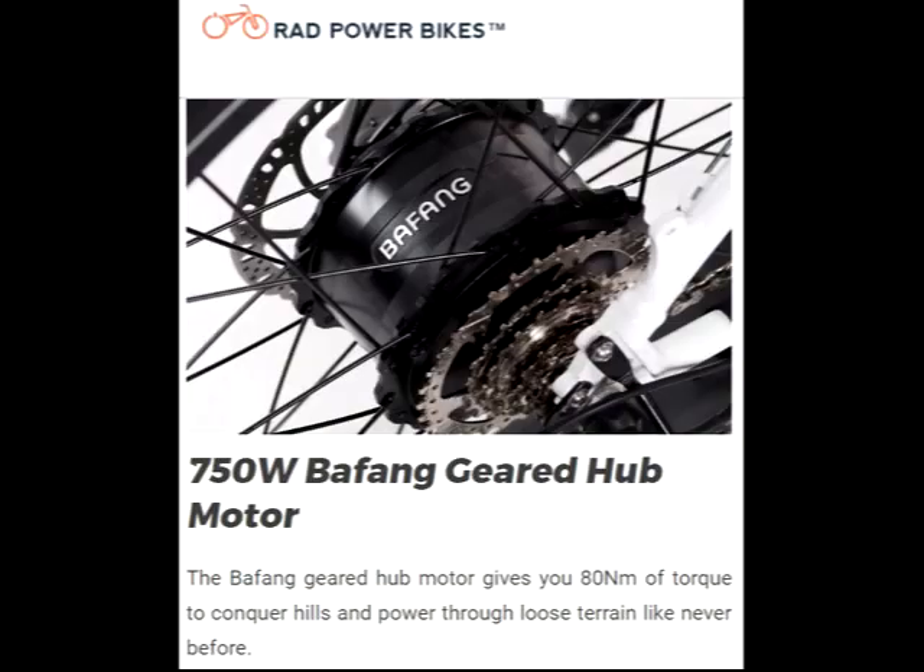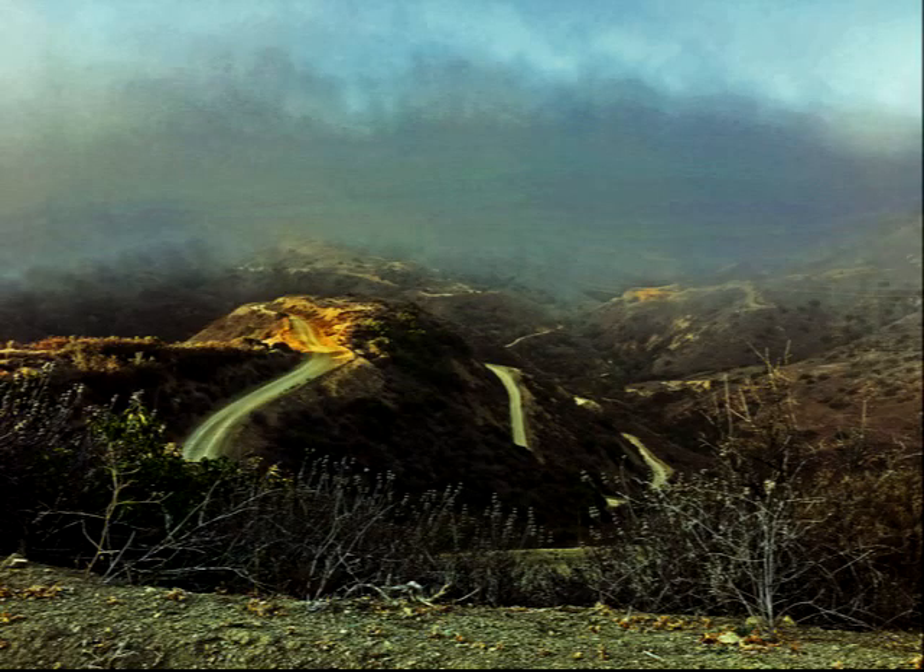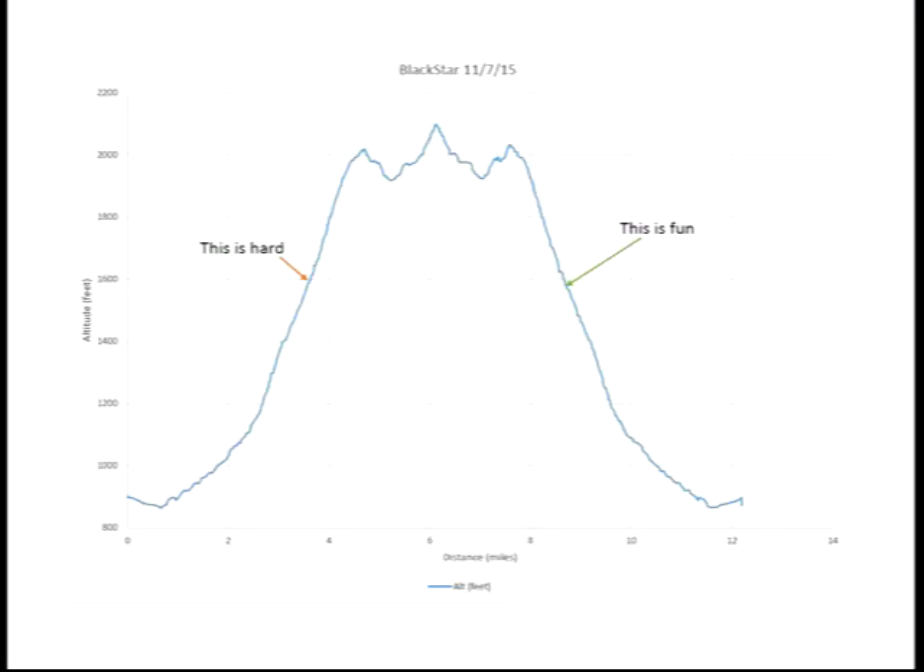Here's the spoiler alert. You may be thinking that you have a 750 watt motor. I have suddenly lost power two or three times before when I've climbed long mountain roads that average about 8% grades at about 10 miles an hour, still using all 750 watts but pedaling pretty hard — I'm a 215 pound 64 year old man. In that situation the shutdown is caused by an over-temp sensor in the motor, and after about five or ten minutes I can begin operation again.